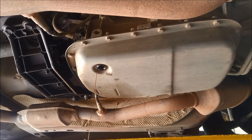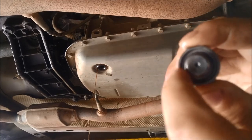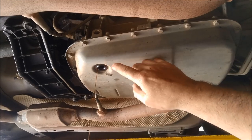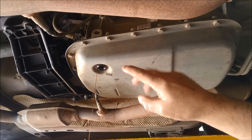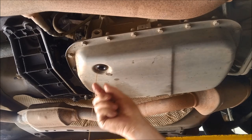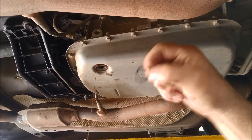There's a little O-ring on that plug — you can see where that groove is, and that's where the O-ring sits. This one's actually still stuck on the pan there, so it's a good idea to replace those. That way you don't have to over-tighten that plug to stop it from leaking. There's the O-ring there, it's just stuck on the pan.